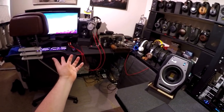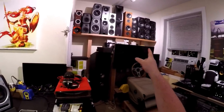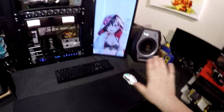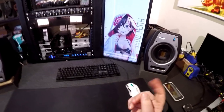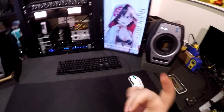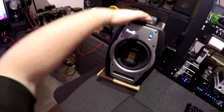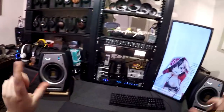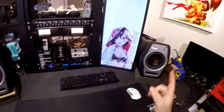Those Adam Audios are cold, like the JBLs. But my big Emotivas got warm and just stayed warm all day and night. These, if I don't play anything on them for around 10 minutes, the Fluid Audio logo dims to half brightness, you hear a click-click, and they go to sleep. They draw a quarter of a watt each in standby — I have a Kill-a-Watt that confirmed it. They're basically off.